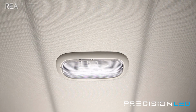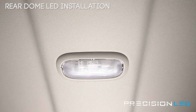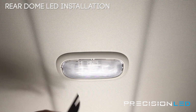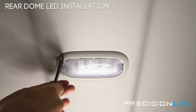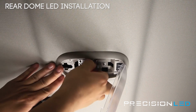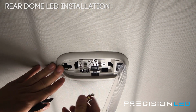We're looking now at the rear overhead dome light in the Patriot, and this is very similar to the overhead map lights. We're again going to use the pointed side of our serrated knife tool, inserting into the indentation here and prying out the lens. We have a very similar type bulb. This one just gets pulled out, and we put our new LED in.